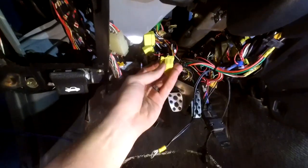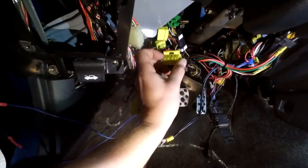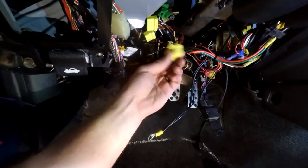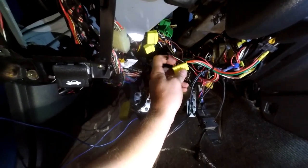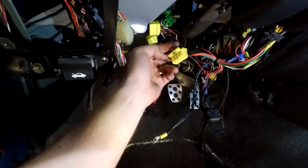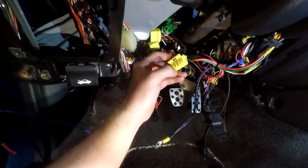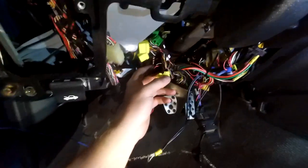So what you need to do is I pulled the ECU back out. This is connector B48. The pin in B48.5, which is the fifth, this red one right here, which like these empty ones on the side here, it starts with, this is 1 and then that's like 22, and so 3, 4, and then 5 is this red one right here. So you need to de-pin this one. This is the MAP sensor ground, but on the 20G ECU, this is actually like an EGT temp sensor thing that's not used. Really, it doesn't matter. It's not going to hurt anything not to have it. I mean, nobody has it.